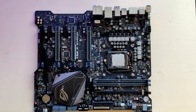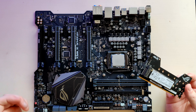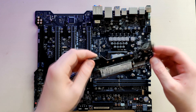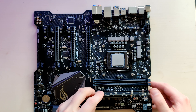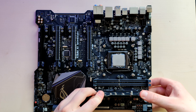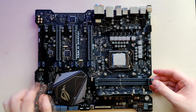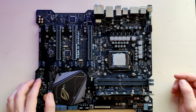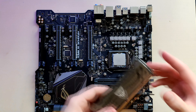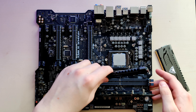That's actually kind of it. The only thing I haven't shown is the DIMM.2 — there are no M.2 slots on this board, so ASUS turned two M.2 slots into this weird DIMM-like thing where I have my boot drive. You slot it in like this — I really don't like ASUS's weird slot where there's only a latch on one side and this weird mechanism on the other side. It feels like you're breaking something to plug things in and take them out. But yeah, you get your M.2 slots that way. Then of course your two RAM slots — my usual test bench kit is just some Hynix CJR. Honestly this motherboard deserves B-Die, but I don't have any B-Die for my test bench right now.